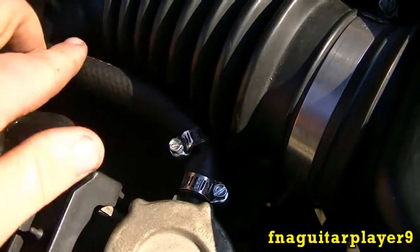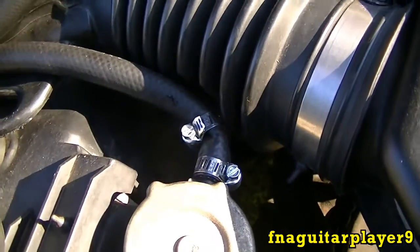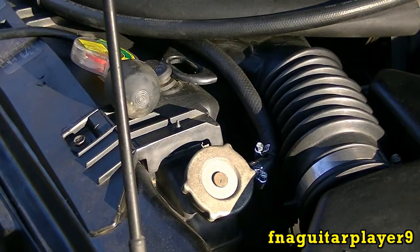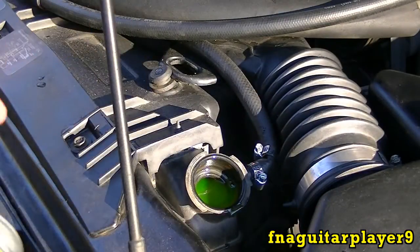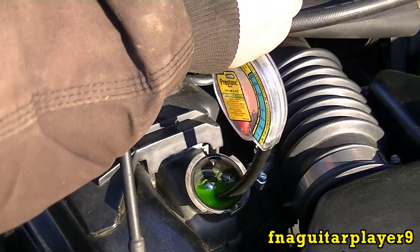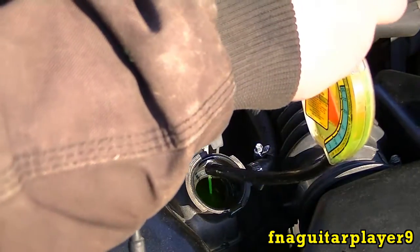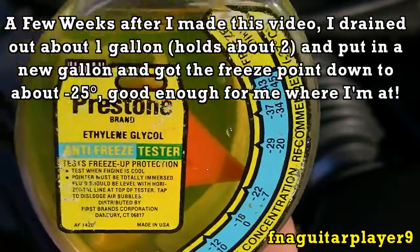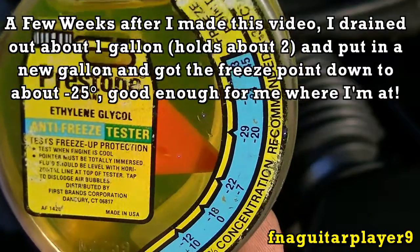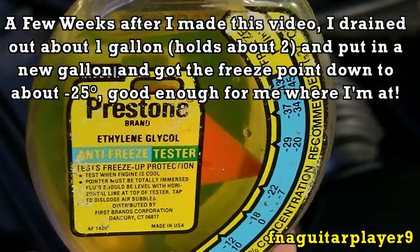You're probably noticing my hose setup for the overflow reservoir — I had to do it like this because it was missing the hose that's supposed to be on there. It doesn't look so good but it works. Car, truck, van, or whatever, it's going to be pretty much the same anywhere you look. You just put the tube down in there and let it fill up. It's not as discolored as I thought it would be. Holding it upright, it's saying negative seven — so I actually need to change the antifreeze in this thing. But luckily here where I'm at, it doesn't usually get below zero, so I should be good.